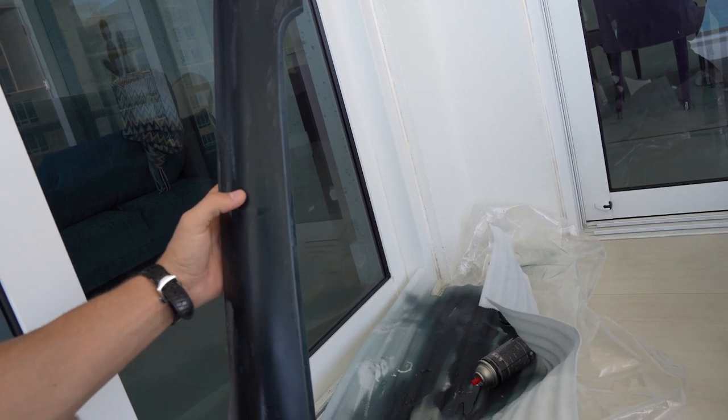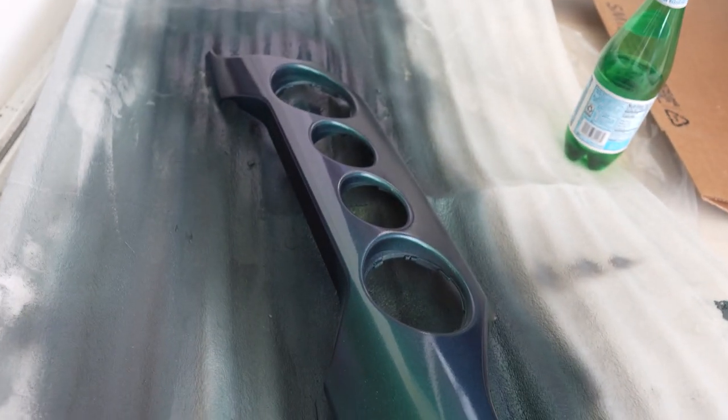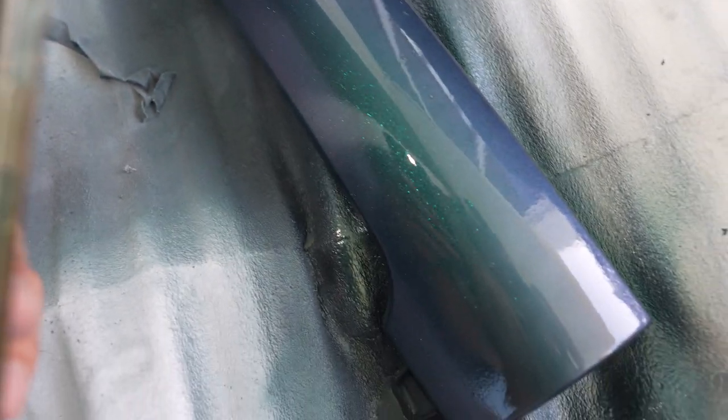I'm not going to show much of this process — I just wet sanded it down with 800 grit, put some water on there, sanded it down, and now I'm going to respray it. I just got done spraying for the second time and went through the whole mess of primer. This actually turned out really cool — in different lighting it'll be green, and from the other side it'll be purple. I like this a lot better than before. I used Dupli-Color shift color-shifting paint plus a Clear Effects multicolor metallic effect from AutoZone.